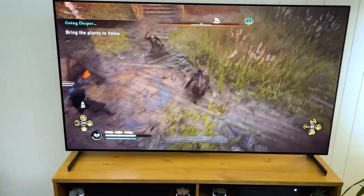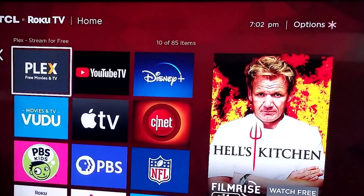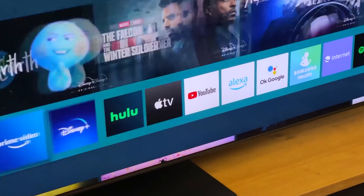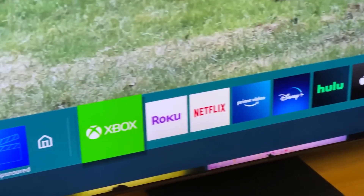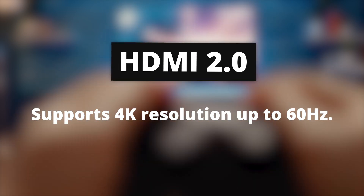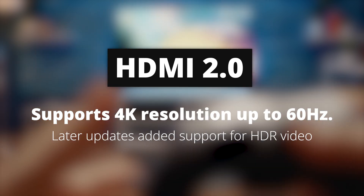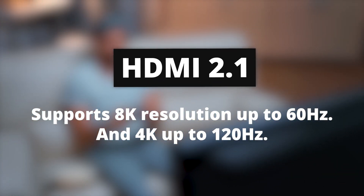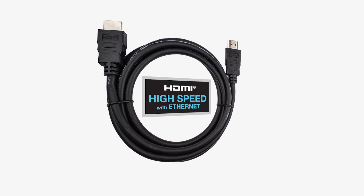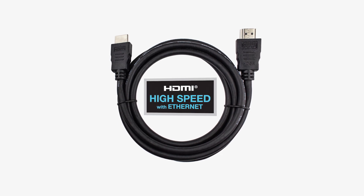A TV may have several distinct types of HDMI, and newer versions will accompany newer models. A more recent TV might be compatible with a cable or device that uses an older model, but it won't make the most of the TV's capabilities. Here is a quick overview of HDMI's several iterations: HDMI 1.4 supports 4K resolution up to 30Hz; HDMI 2.0 supports 4K resolution up to 60Hz, with later updates adding HDR video support; and HDMI 2.1, the latest version, supports 8K at 60Hz and 4K at 120Hz. Be sure to check the packaging of your HDMI cable for the HDMI high-speed logo if you want to be certain that it supports Ultra HD 4K quality.